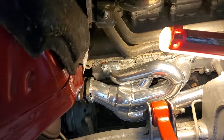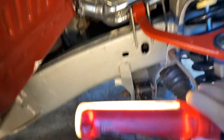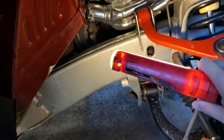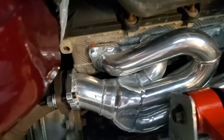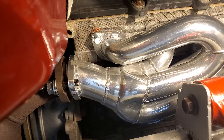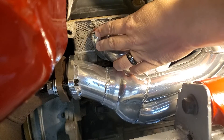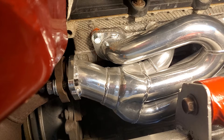How we had to get at most of the bolts on this: the top bolts we were able to access from up top. The bottom ones we had to lay on a creeper underneath the truck and roll in and reach our arms all the way up underneath to get at these bolts. These were probably some of the worst bolts I've ever had to access in my life, because the pipes themselves are just so tight. A lot of them you have to put in finger-tight only because you have to snake your hand in to twist the bolts until they're bottomed out. I would suggest to anyone that wants to do BBK headers or any shorty headers - it doesn't matter the brand - you might want to chase your threads with the proper thread tap so that your bolts will thread in loosely by hand almost all the way to the bottom. That will save you a bunch of time when you're trying to put a wrench in there that you may only get an eighth of a turn before you're out of space to tighten.